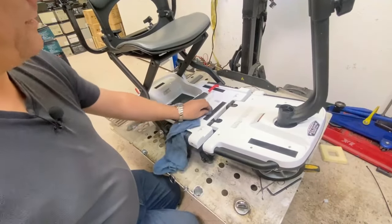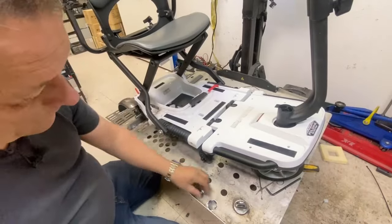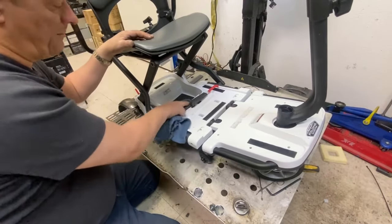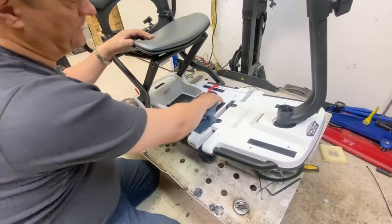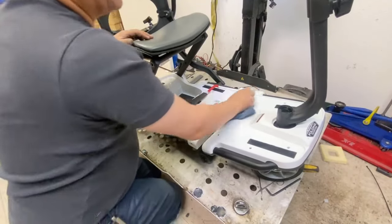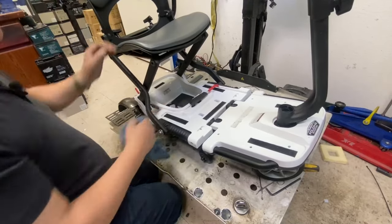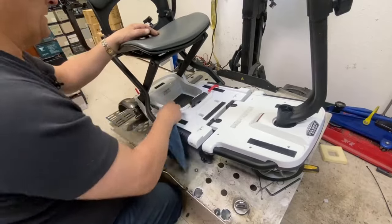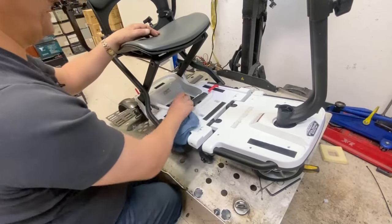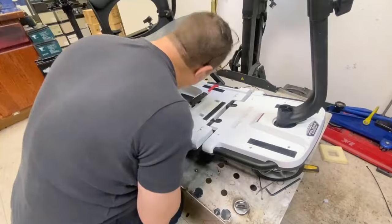I was thinking about battery packs. Wondering if you could fit little 10 amp hour batteries in a 12 amp hour battery pack, if you had the space, because I was editing the Metro scooter video last night, and it has quite a large battery pack, similar to the Pride, the little 12 AH battery pack, but it's a lot larger inside. And I was thinking, could you do two 10 amp hour batteries side by side, wired in parallel, and then wired in series, giving you 24 volts.